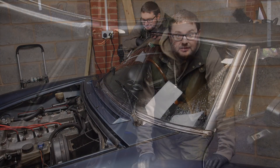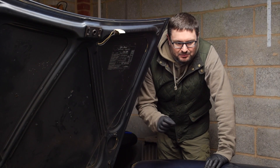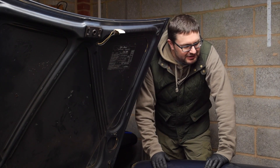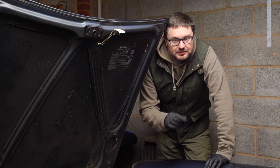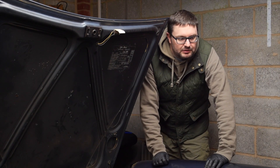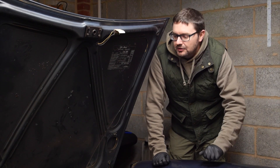So that's it for episode 10 of Take It to Rose Garage. I'm really happy that I've finally sorted the wipers out. I would like them to be a lot faster, but I think I'm just going to accept that that's what old Alfas do — old Alfas and slow wipers go hand in hand. I am pleased I replaced the motor because the old one definitely was on its way out; that damaged armature wasn't good and that wiper motor was going to fail at some point. So it's peace of mind now that I've replaced it with a new one, and that's another job ticked off the list on this Alfa.